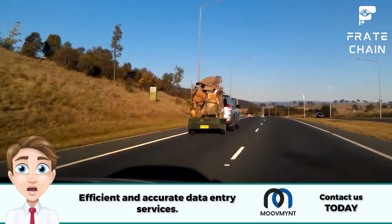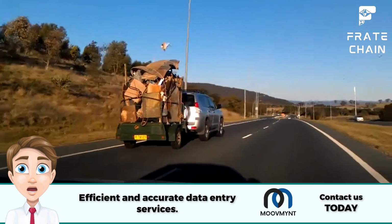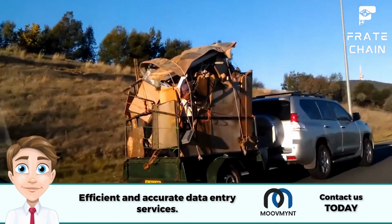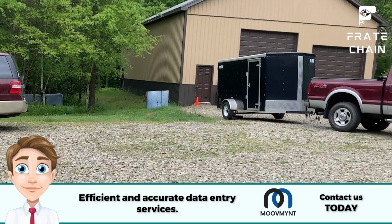Don't overload. Cargo trailers have weight limits for a reason. Overloading your trailer can strain its axles, tires, and other components, leading to potential damage and safety hazards. Make sure to always stay within the weight limit recommended by the manufacturer.